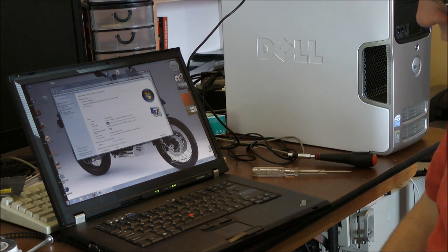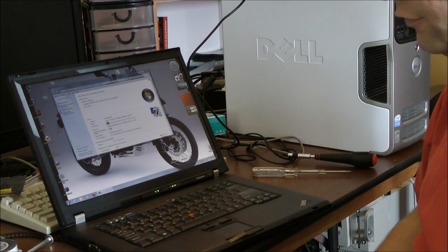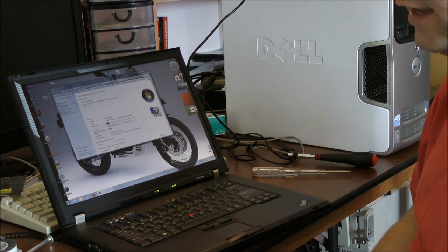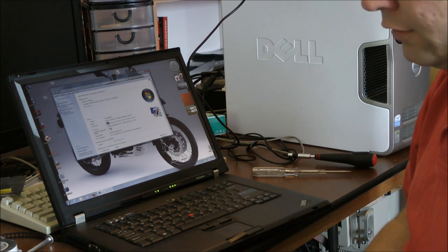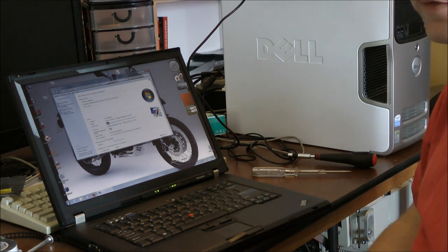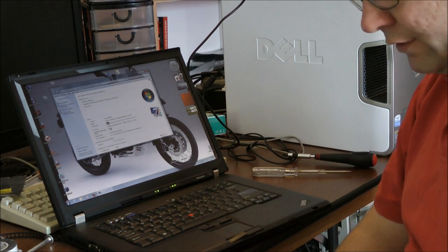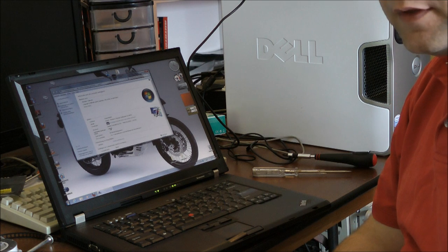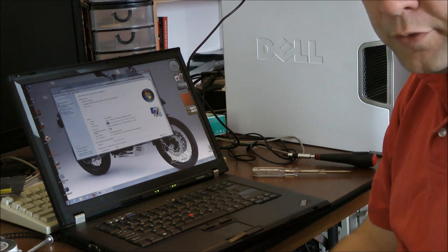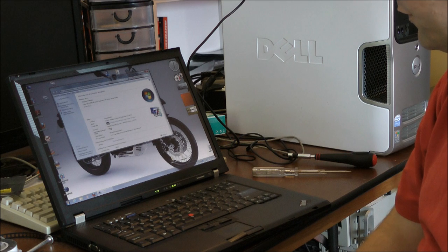This laptop can be upgraded to 8. But Kingston does not sell such large modules, and it is just a laptop with a 2-core CPU, a T8100, and I won't need that kind of large memory. What you can always do when you have some problems is boot with a CD of Linux Ubuntu. There's a memory check in it, and you can do a memory check for 2-3 hours. Then you know if the memory is okay, if you have questions about function or not.